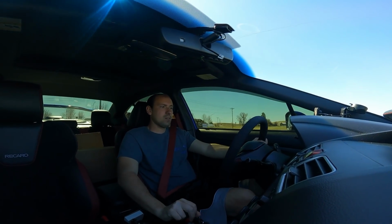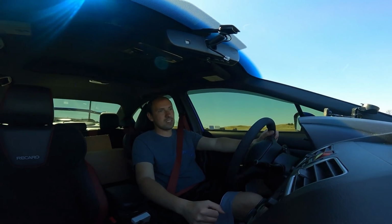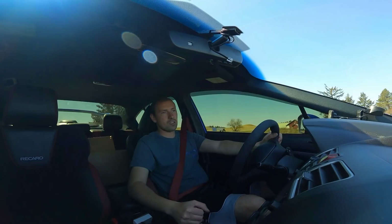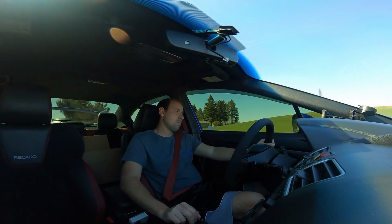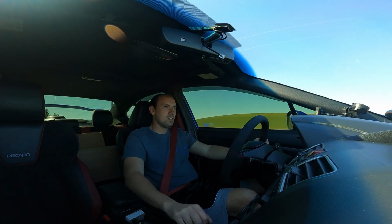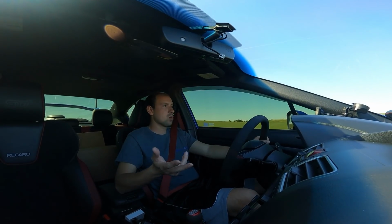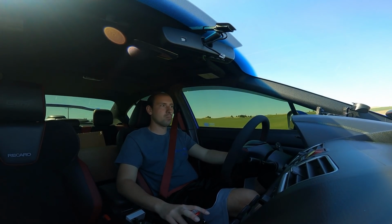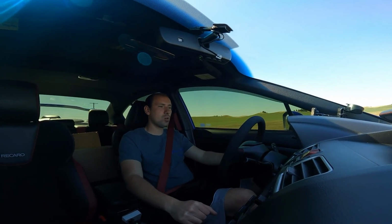It does respond very well. The FP Greens have always been a good responding turbo. It is our go-to when it comes to turbos for a stock location. So you do get some turbo noises, obviously being a front mount car anymore, and we run a Tial 50mm blow-off valve on them. So you definitely get a lot more out of the car, a lot more enjoyment.